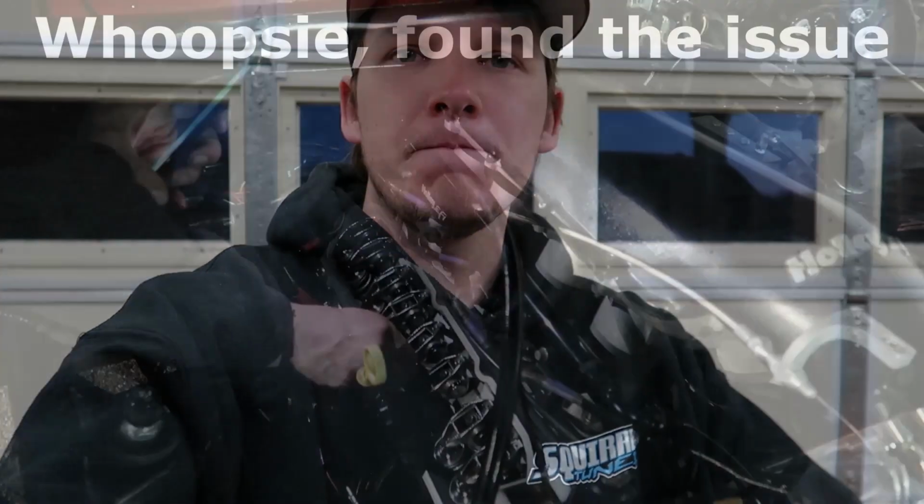Alright, so there you go, personal best in Amarillo right off the trailer. We were super happy with that, even with a little pedal. The car has a really tight converter, and it shifts fairly high, so with it dropping that hard on the shift, it broke the tire loose a little bit on the shift, and you can see it wiggle a little bit, so she pedaled it and got back into it, and still ran a personal best. We were super happy with that. Now we'll get back to Michael's car.